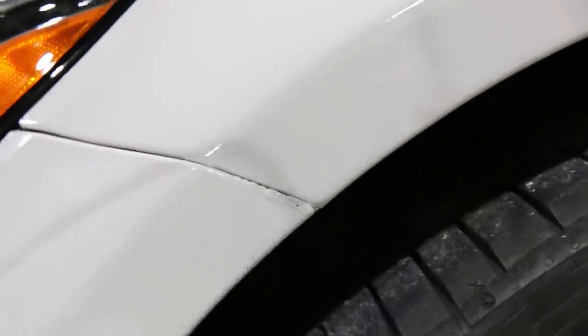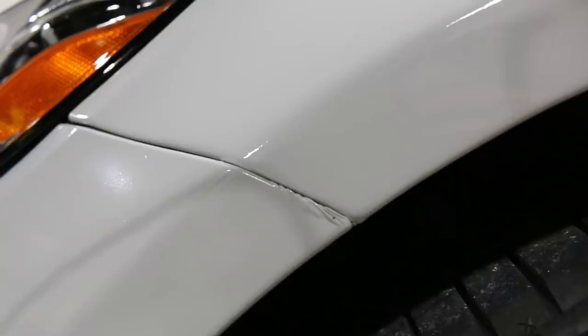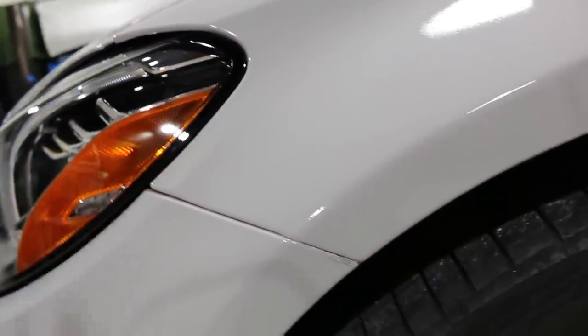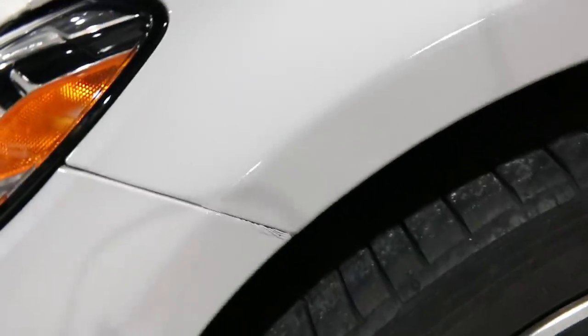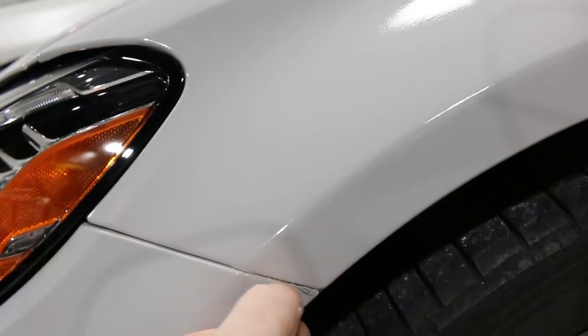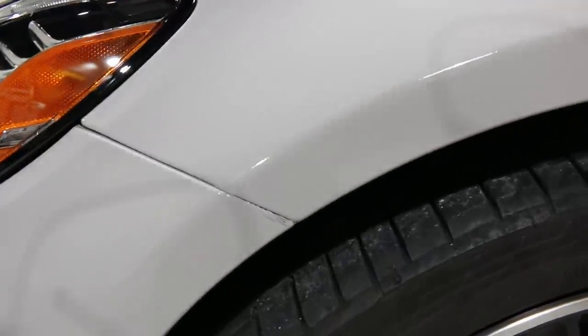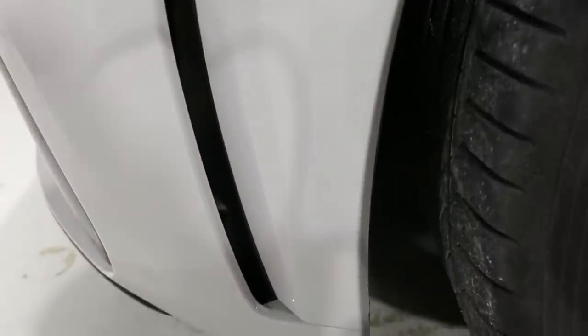Let's check out the other side — the corner and bottom of the hood here, doing nicely as well. Over here I did notice the same thing, even worse. This is not your fault — this is normal wear and tear when driving the vehicle. Sometimes the bumper and fender or other seals sit very tightly together and cause friction from vibrations between the plastic bumper and the opposite panel. This is common unfortunately, and there isn't a whole lot you can do about it other than not tucking the film around so far. Now that I've seen this, I'm going to trim it off mostly right at the edge so we don't have this happen again — this is something you can't predetermine until it actually happens. All in here is actually still pretty good.